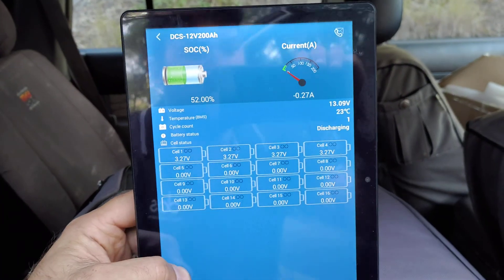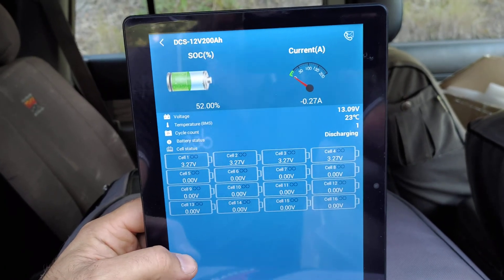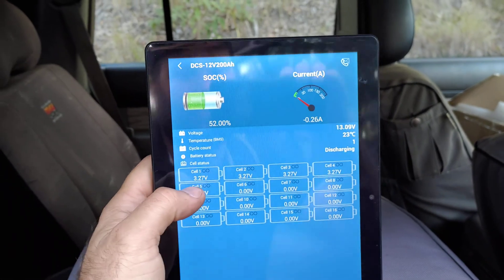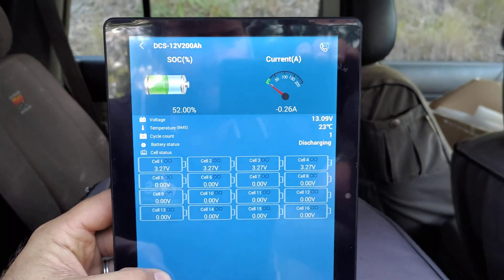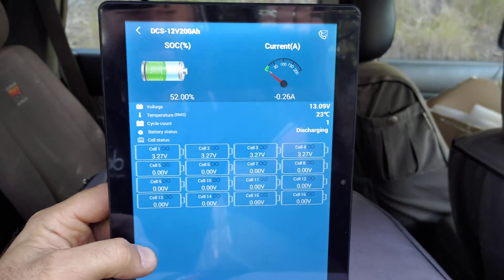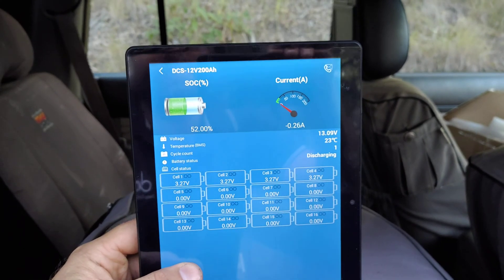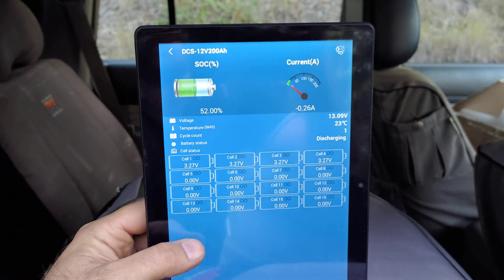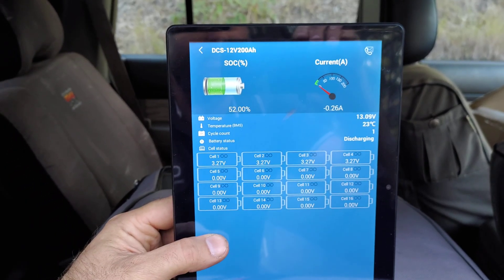You've got around 170 to 180 amp hours of usable lithium capacity for all your accessories. We're logged into our app, which is accurate down to 0.2 amps. You can see the fridge load and standby draw is 0.27 amps, and the battery is sitting around 52%. You can see how even all the cells are — 3.27 volts across the board — because of our very precise cell management. DCS batteries give you full 100% capacity, so our 200 amp hours is 200 amp hours usable. The Victron smart battery protect cuts off loads when there's a little juice left — programmed at 12.5 volts to switch off.